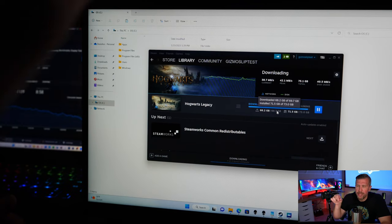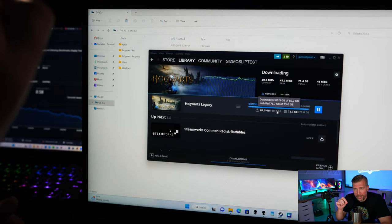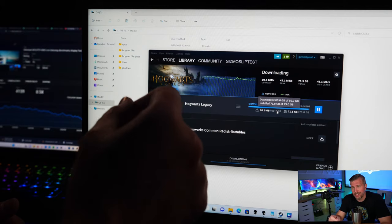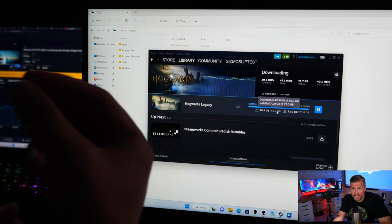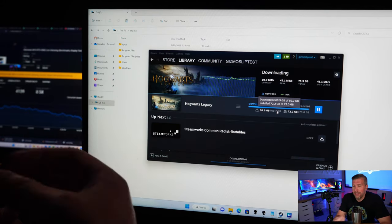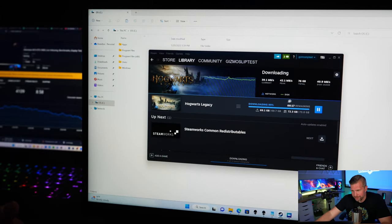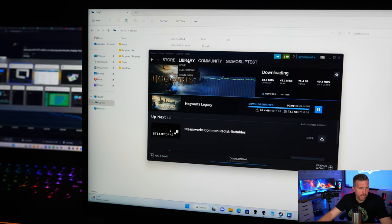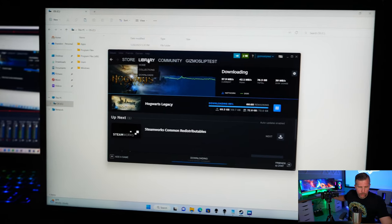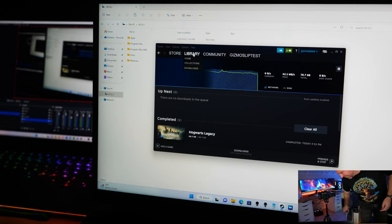What you want to do is copy all of your key files onto an external SSD or an external drive, and then you'll want to start a new fresh install with that new laptop. And if you're trying to put a new SSD in there, like an upgraded SSD, you'll want to put that in there formatted. So wipe that SSD clean, and you'll want to use an ISO Windows install file from that manufacturer, because there are now key drivers on the SSD itself that each manufacturer puts on there that basically make it so you have to use the Windows install file from that support page. Otherwise, it won't work well.